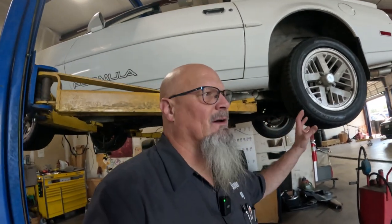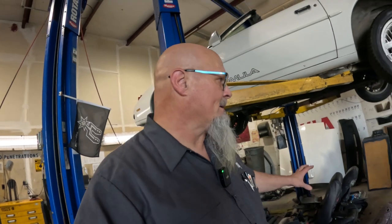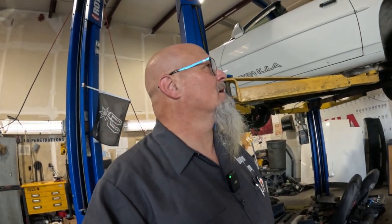We got a 10 bolt that has a GM Posi-Traction. It's a good setup. It's just gonna run with that. So we're gonna take this axle out, and we're gonna put the other one from the other car in, and of course we're going to clean it up and everything, and put a disc brake setup on it. But we're not going to do that today. What I need to do is move all this stuff out of the way, pack some of this stuff up so I can take it to the storage unit, and let's get up in here and let's see what we can do.